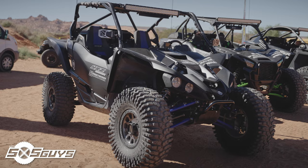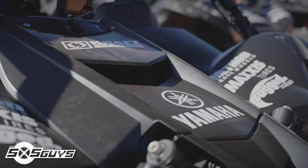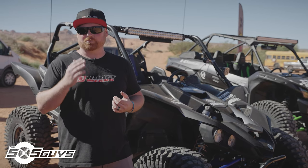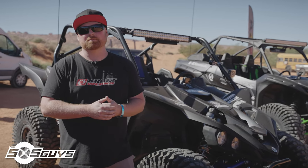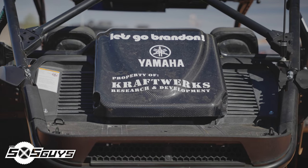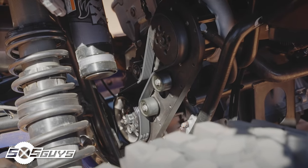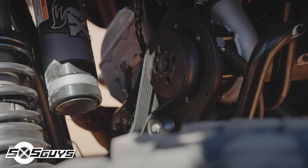Next, we have the Yamaha YXZ. We have two different kits — one for 2016 to 2018 and one for 2019-plus. The main difference is intercooler setups and boost levels, because the 2016–2018 models have slightly weaker rods, so we turn down the boost. If you upgrade the rods, it's an easy pulley swap to bring boost up to where the 2019-plus can handle. On the 2019-plus kit, the intercooler goes in the factory location so you don't have anything up top — it gives a nice factory look. We'll have pulley upgrades, upgraded injectors, and everything for guys that want to turn up the boost.